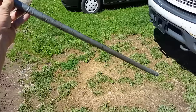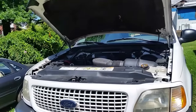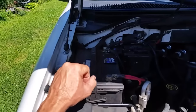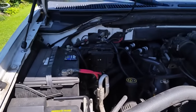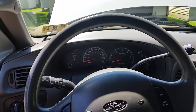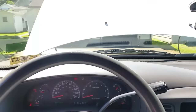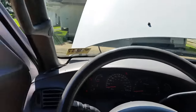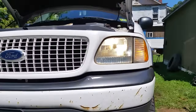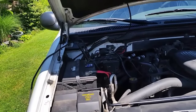The first thing we've got to do is locate the battery and find out if it has lost charge or if there's a bad connection going to the starter. Without any fancy tools, the easiest way to check your battery is to turn your key on, turn the heater fan on, turn your wipers on, go outside and look at the headlights to see if they're bright.